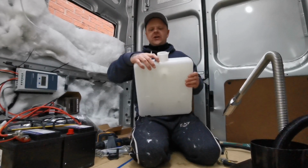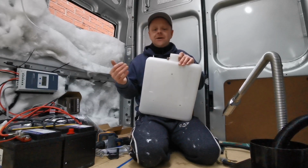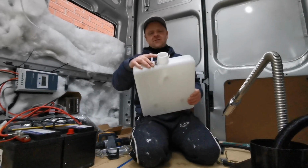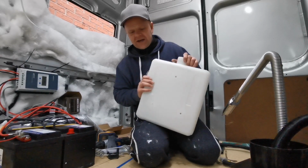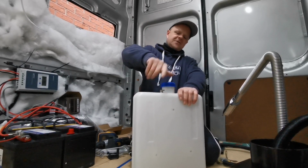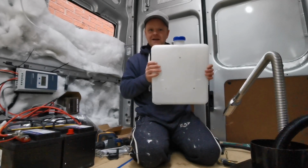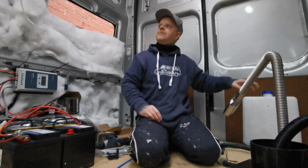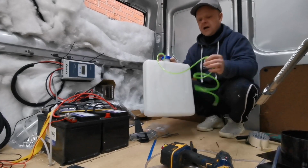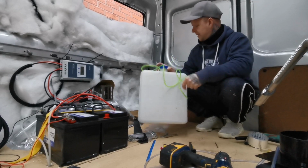So it's fully on now, and I'm as tight as I can, but I haven't got to worry about it leaking. So unless it does that, that is not going to leak. So I'm happy with that. All good. Right, get the lid back on there so no rubbish gets inside. That is the fuel tank ready. I need to get that line back down on. So the fuel pipe is now on. I've left quite a bit on this just to allow it to go to the pump.